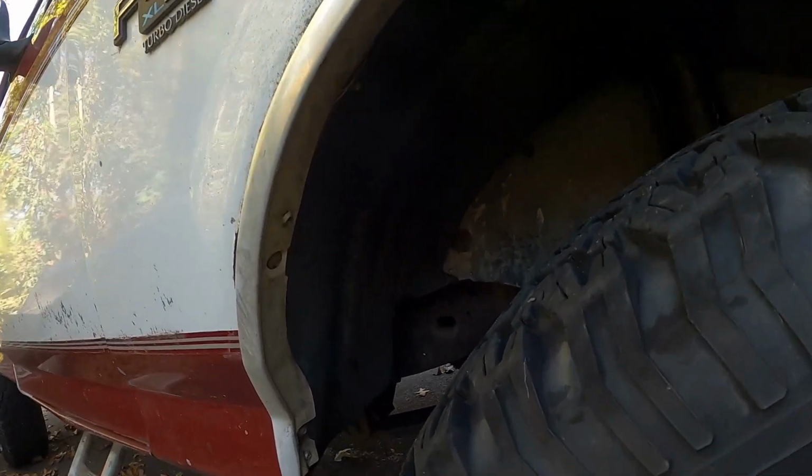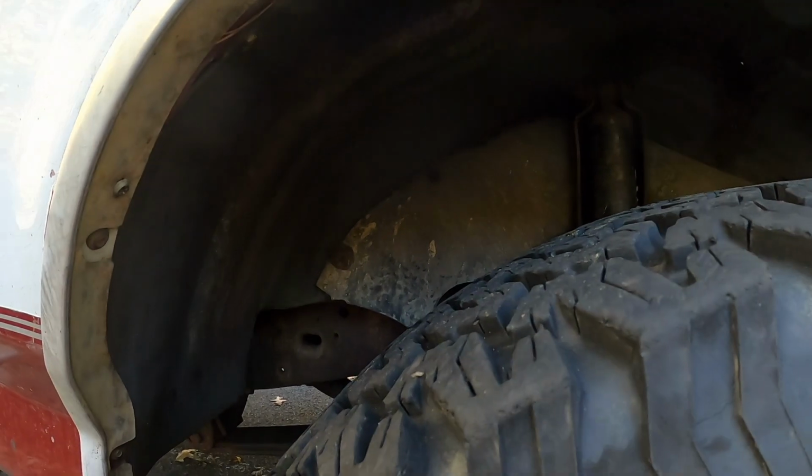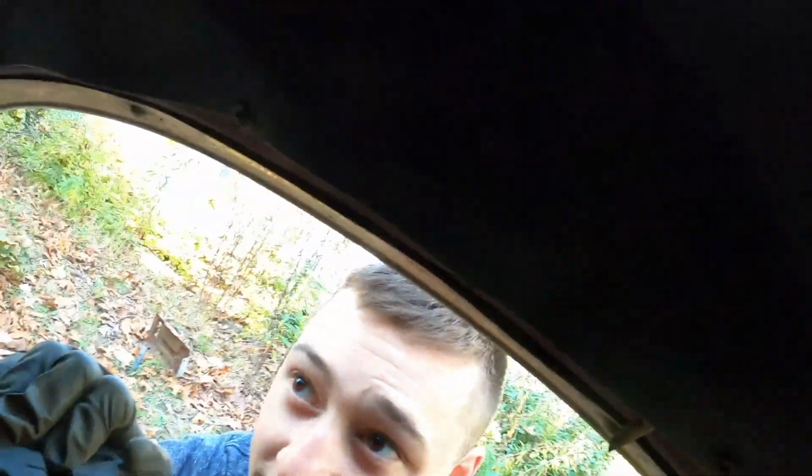So on the passenger side, I guess I'm just gonna show a little bit of the teardown. So I'm gonna take the wheel well ones off first. So there's a couple little ones right here. One there, one there. There's like 1 or 2 underneath there, and then there's also like 1 here and 1 here, which I didn't realize because it's hard to see, but they're there, and you won't be able to take the fender off until you get those.